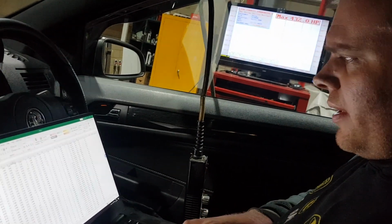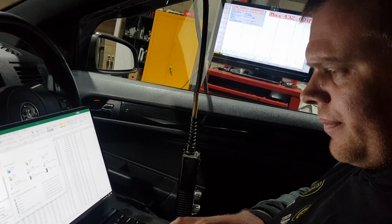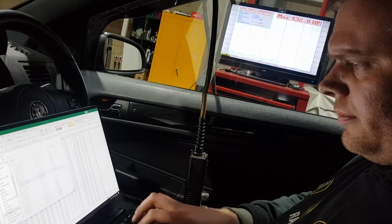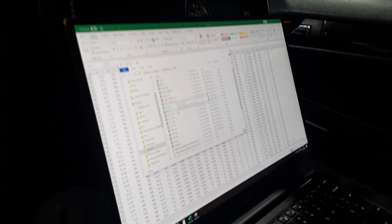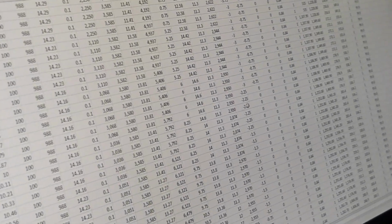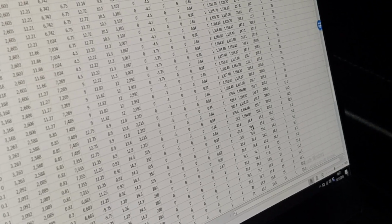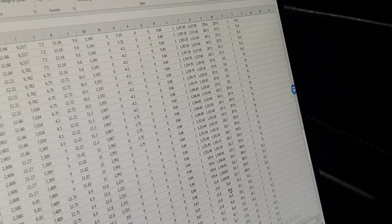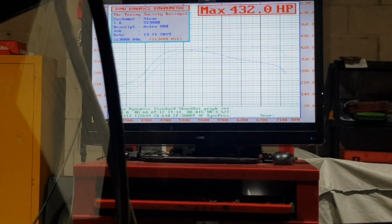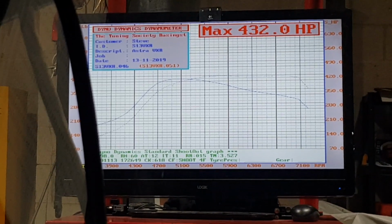We're currently sitting around, where are we, total run, airflow. EFR, V10, 4. So your airflow's up here somewhere around enough airflow to make sort of 450. We're slowly getting the timing back, but it's still finding the graph is going very flat and arcing over. So I think, you know, good time in this car, 450 is probably a lot as it is.